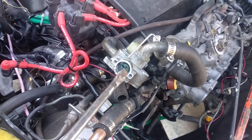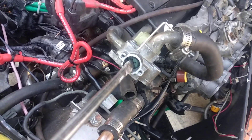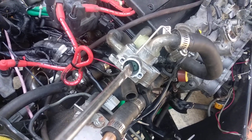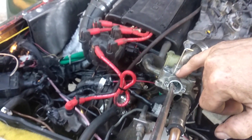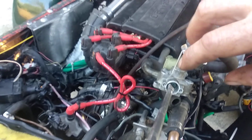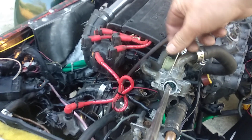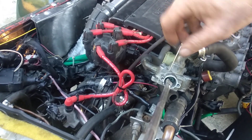For the sake of learning, watch this — anti-clockwise, down to 800 RPM, just where we wanted it to idle. On the side of the IAC is an Allen key. This is the base idle for when the bimetallic spring is real hot and brings it back hard. With this Allen key you can raise your idle or lower your idle.